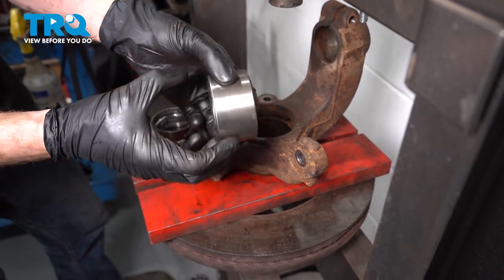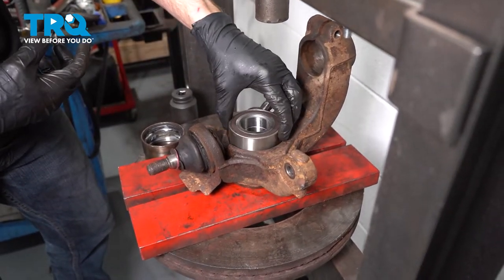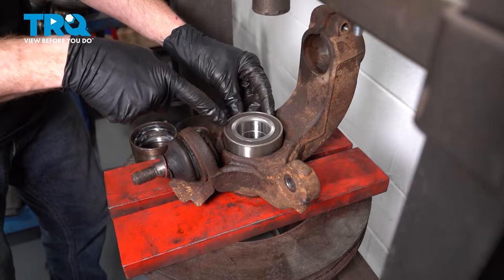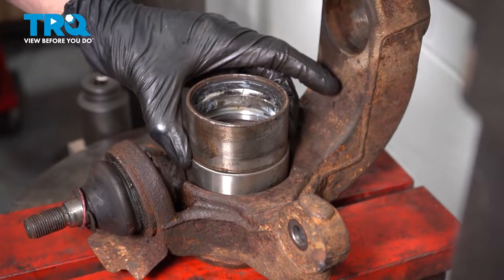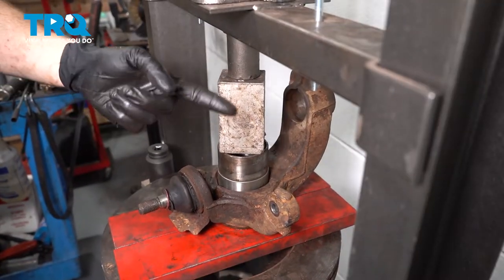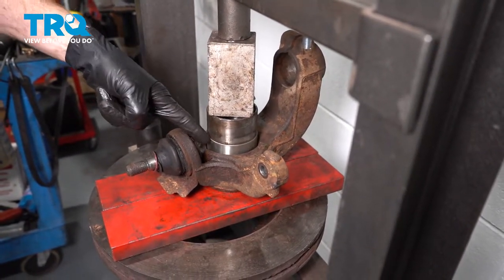Okay friends, let's get ready for our installation. Take that brand new bearing. Have a look at both sides. You'll find that on one side you have a magnetic strip which is for your ABS. Make sure you have that facing inboard. Now that we have that placed into the knuckle, let's continue pressing it down. When you do, you have to be extremely careful and only press against the outer metallic ring here. Never press up against the magnet strip or against the center when you're doing this. We'll use a cup that fits directly over the outboard aspect. Continue on with a spacer. Center it and start pressing it into position. While we press this down, make sure you press it down as evenly as possible. If it looks like it starts going off kilter or going in a little bit more on one side than the other, you need to make sure you straighten it out. Otherwise, you can cause some serious damage to your brand new bearing.